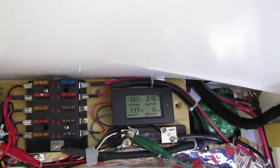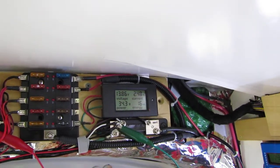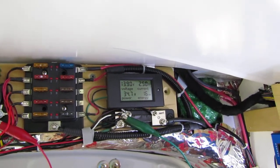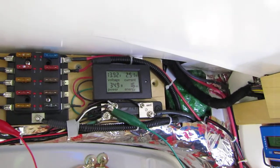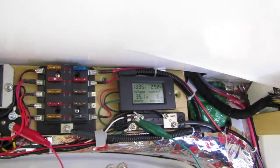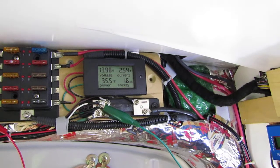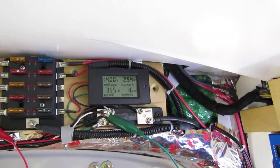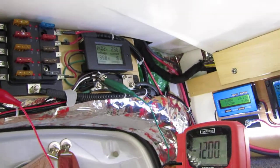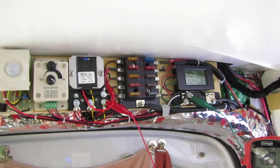Those fans are being used in RVs and vans that have solar and shore power chargers. The guy at MaxAir told me they've had these boards blow up from people running it on the front starter battery alternator system too. In this Transit van, going down the road I normally see 14.2 volts on the front starter battery system, which is completely separate from the AGM battery system in the back. We're already at 13.97 — already over what they say these boards like to see. There's 14.01 right there. He suggested I use a voltage regulator, and they sent me a free replacement board, which was mighty nice of them.